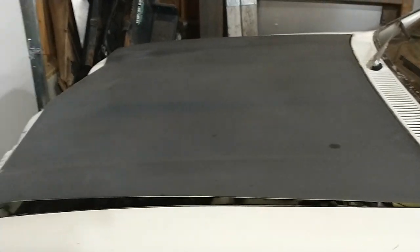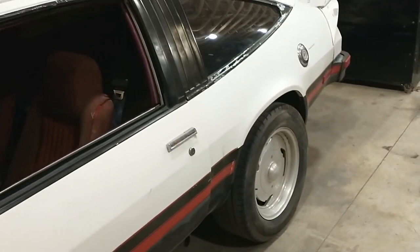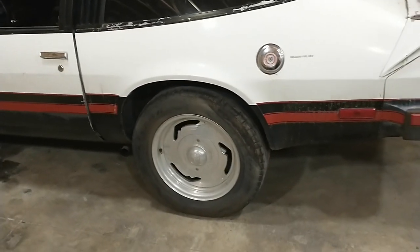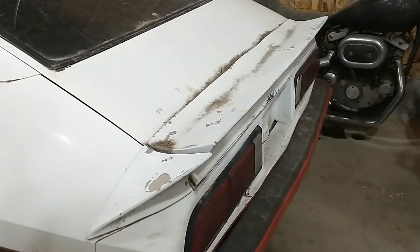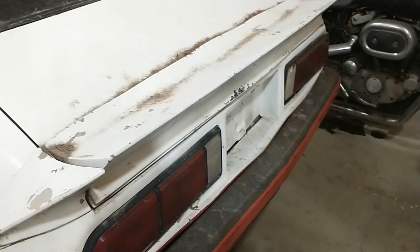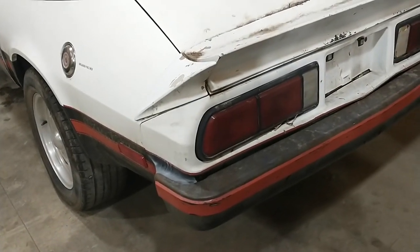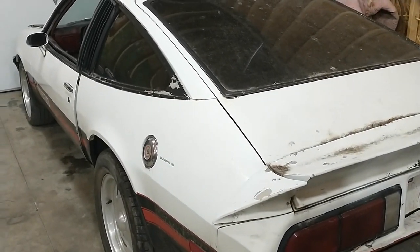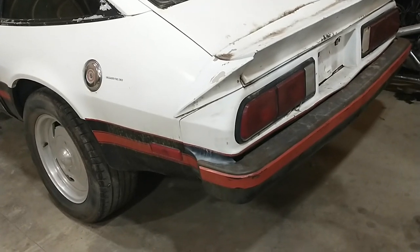It's got a performance camshaft in it. Who knows the output — you can't really believe what the seller tells you, like 500 horsepower or something crazy like that. Probably not even close to that, but who cares? This is going to be my daily driver. The other thing is it supposedly has a 4.10 with a spool in it. It's definitely locked in the back. Whether that's really a spool or somebody's welded the spider gears, I do not know. Kind of makes it a little sketchy on anything but dry pavement. But we'll make it work — they do make a spool for this little 7.5-inch ring gear differential, and I was shocked.